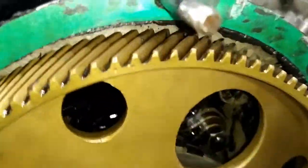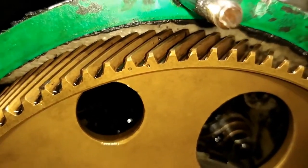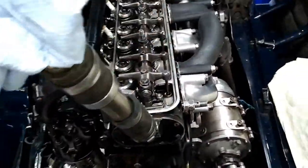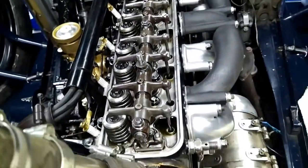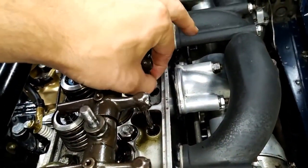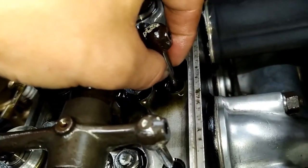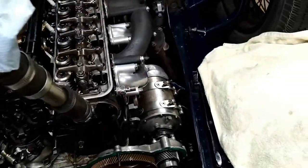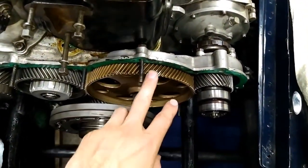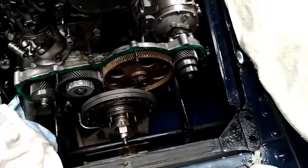Looking down at the bronze gear, you will see that my gear has two centre punch dots — this is for a very important reason. Now that I have IC on the flywheel, I come to the number one inlet valve. What you will find, and what you should be able to do, is turn the push rod — but you shouldn't be able to turn it freely. It should be tight, like this one here. It's a tight turn, not a free turn. It's just closing — this is imperative. If you get this wrong, you'll be out. If you're a tooth out here, you'll be over two and a half degrees out on the flywheel. You'll have an ill-running engine and could cause catastrophic damage, so be very careful.